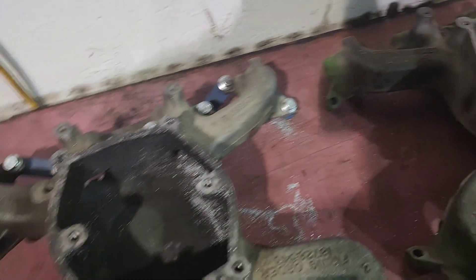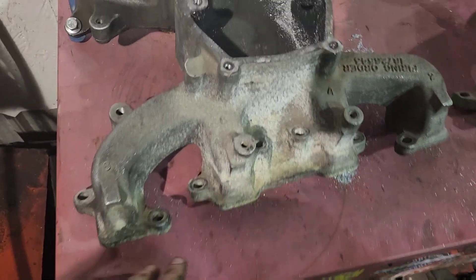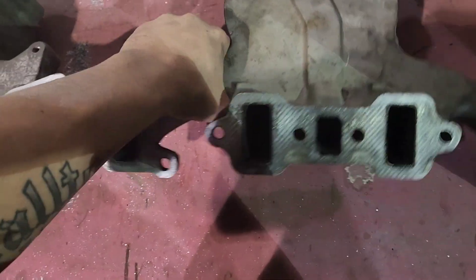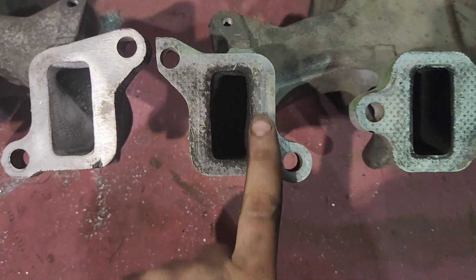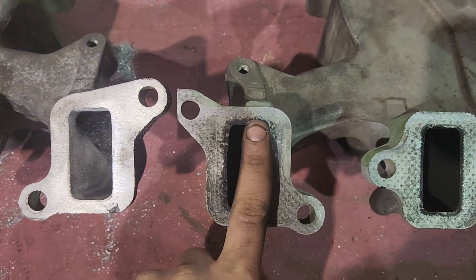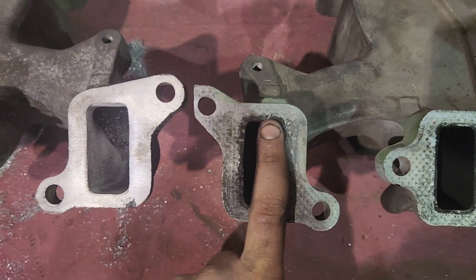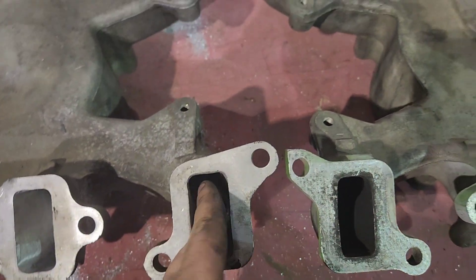So that is the big difference — a side-by-side comparison between an F-Vin and an S-Vin intake, showing you guys the ports and the differences. And that just puts it in big perspective right there. This little guy is about as wide as my finger. Big difference — and that just shows you the big difference in port size, smoothed out around the radiuses, a lot more free-flowing into the heads.